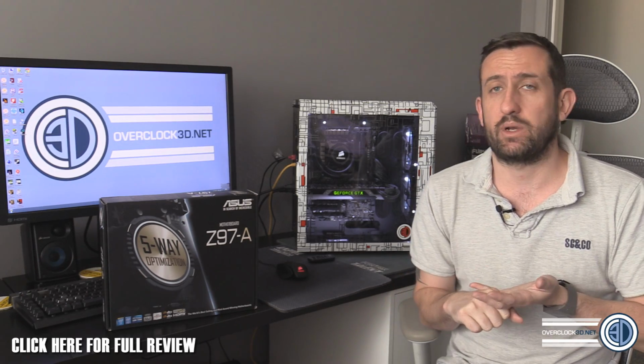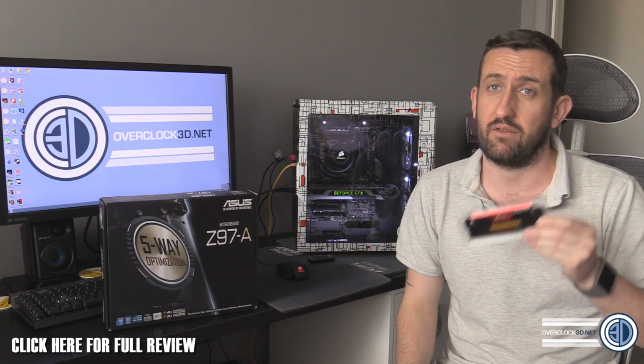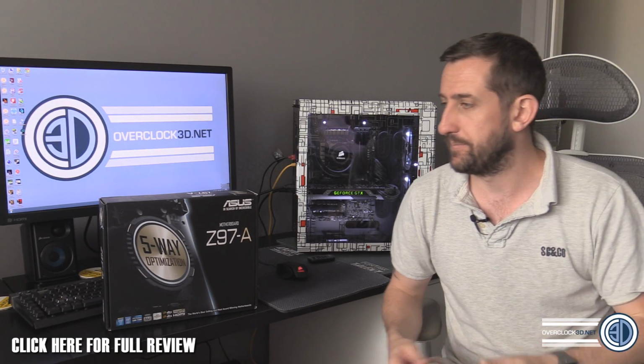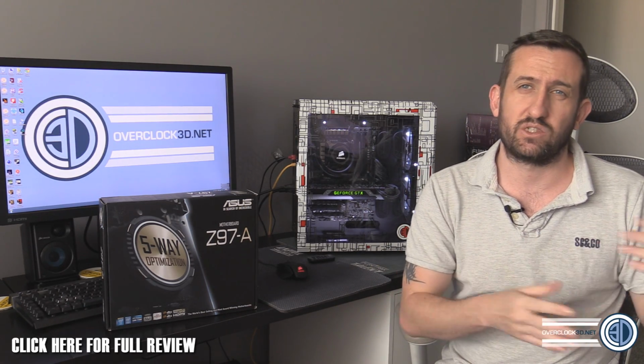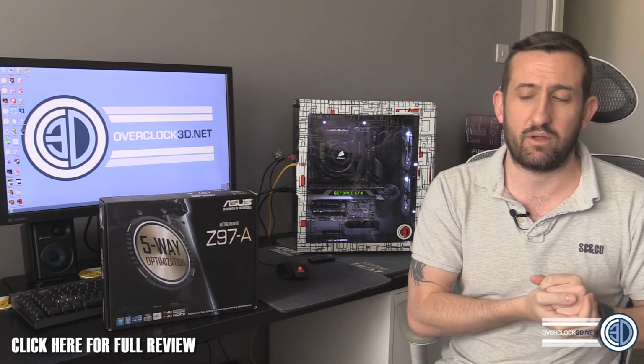And we have got some 2933 Corsair Vengeance Pro memory that we'll be using to test the boards to see if they can do high memory speeds as well. So we can chuck a little bit extra in there. And then we have changed around, whereas before we did stock tests, which was basically 1333 memory and the CPU running at stock, we've now just moved on to overclock tests.